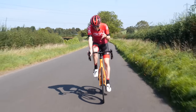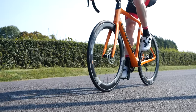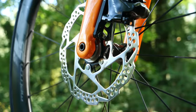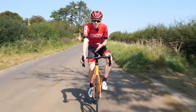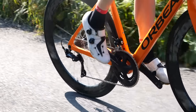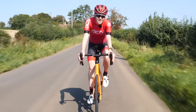Now 105, it shifts beautifully too, and as for braking, way superior in both rim brake and disc brake versions. It's also far more versatile with regards to gearing options on the chainset and the cassette. And when it comes to replacing worn components, it's going to be much more friendly on your wallet.